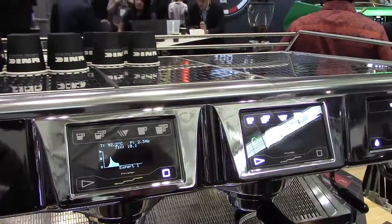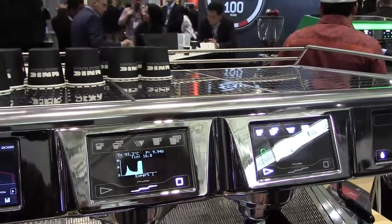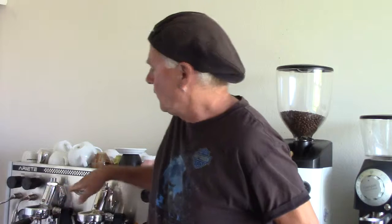Now what you've done, you've completely saturated the group, and now you can reintroduce the pressure at the end. So now you can extend the contact time without keeping the pressure on the coffee the whole time. And then you're going to get, where on the E61 you get a paddle on the top that restricts the flow in the group head. I predict that's going to be every E61 home group machine with the double boilers, they're probably going to add this. There have already been two machines doing it now, and they're kind of chasing each other on profiling.